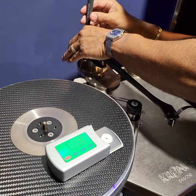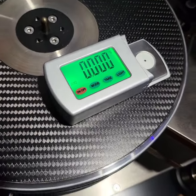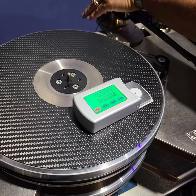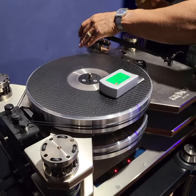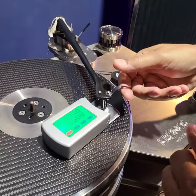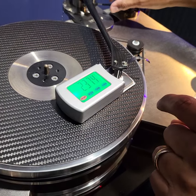So this needs to weigh about two grams so that when it sits on top of the record it doesn't make the record stop spinning. You don't want it to be too heavy. But too light is also a problem — if you have a small particle on the record it might send the needle skipping. It has to be the exact tracking force, so we're getting close here.